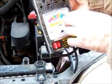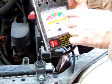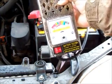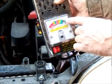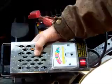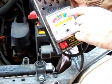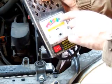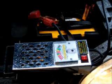We're right in the good zone — just a little over 14 volts, about 14.4 to 14.5. Now go ahead and turn the heater and lights on. You'll notice the needle bounces, then the regulator picks up and I'm still in the good zone. That tells me the charging system on this vehicle is working well. Below 14 means not charging; above 15 means overcharging. After starting, you want to be in the green and stay there even with accessories turned on.